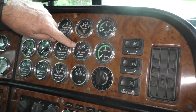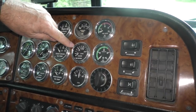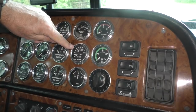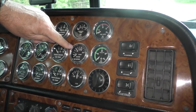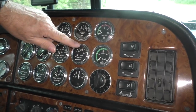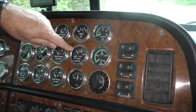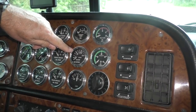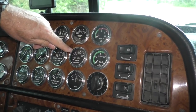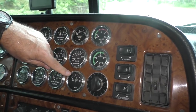This is my rear suspension gauge — basically it shows the air pressure on the fifth wheel. They vary from truck to truck; you'll get to know it after you've loaded and scaled a few times and then checked your load gauge. On this truck, when I've got 34,000 pounds sitting on the drives, it's at 60 pounds when sitting flat and level. So it's a good indicator when you're loading somewhere and you're not near a CAT scale — you can check your gauge and see how close you are to your correct weight on the drives.